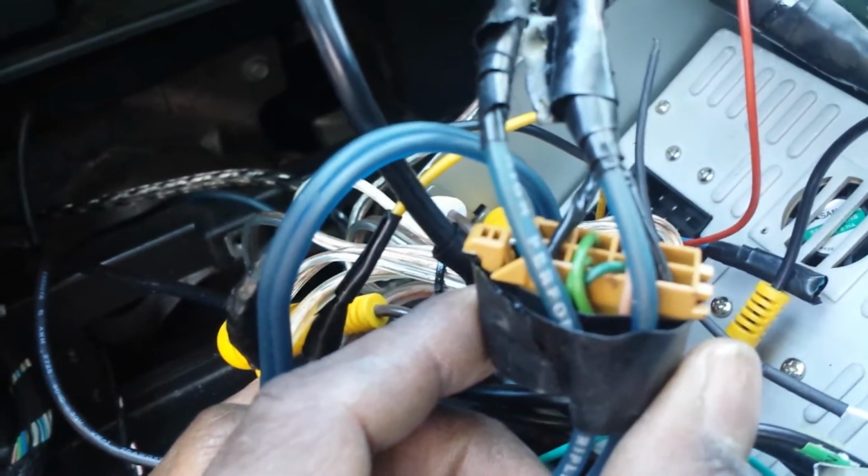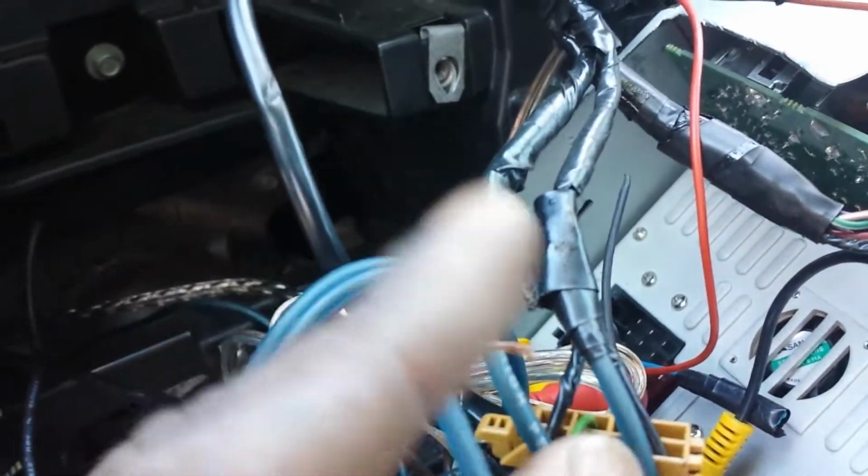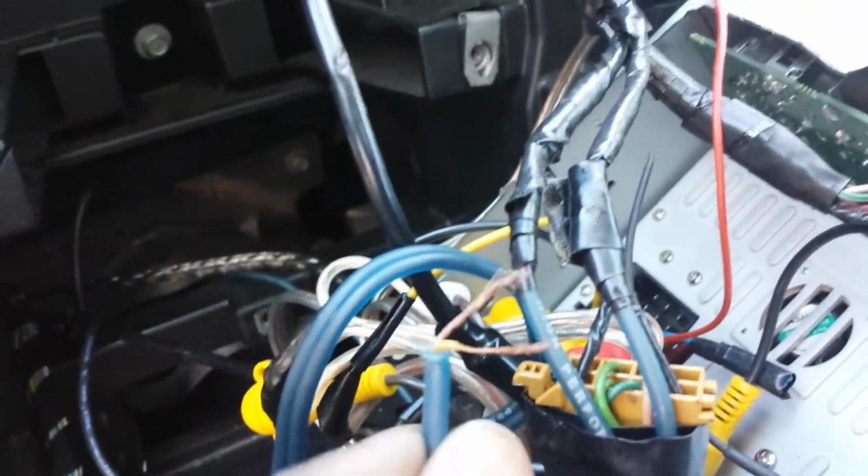The wires that you're gonna cut are, see if you can see those. I don't know if you can make out all those colors. There you go. But I cut them far enough back, and I went back in the harness a little bit so that I could make my connections. And you're gonna take from one side of it, and you're gonna connect where you cut for your 2 light greens at. You're gonna connect them to one side of this, to those 2 wires. The other side, where you have the brown wire and the dark green, you're gonna connect those to the other 2 sides.